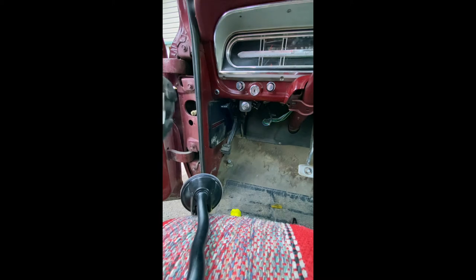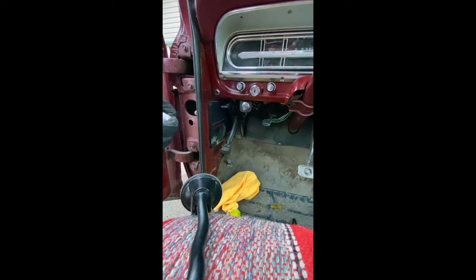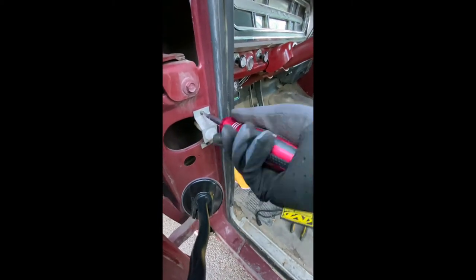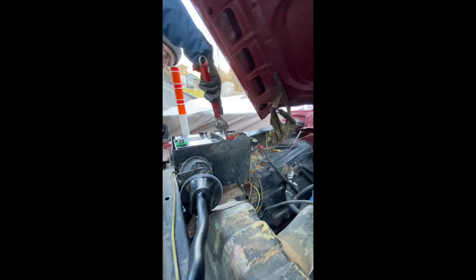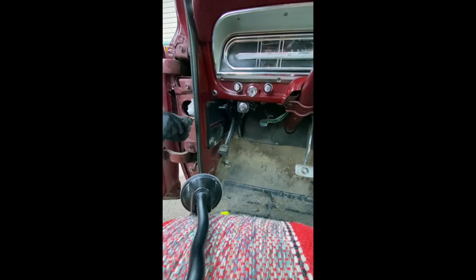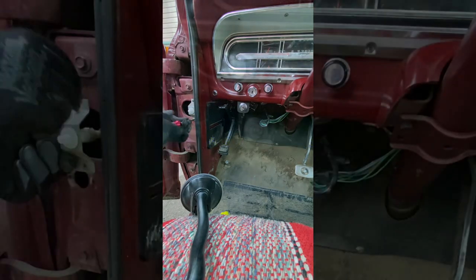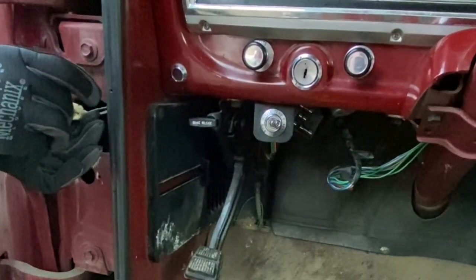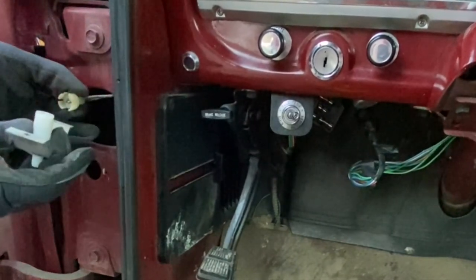I took that old faulty switch out. Apologies throughout for the iPhone vertical filming and poor camera angles — I plan on sharing more of these DIY project videos to the channel and I'm going to get better at production as I go. I connect things back up and get the battery hooked up again, but I'm not getting light on that courtesy switch — the new door jamb switch — though it functions off this. So I disconnect again, and here's where that orientation comes into play. I flipped it around and reconnected.